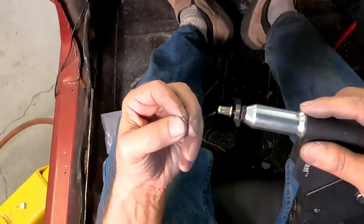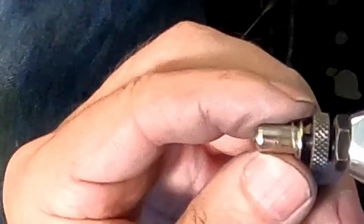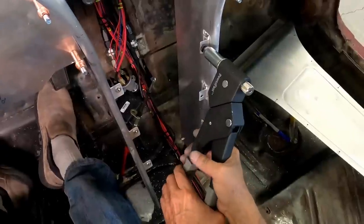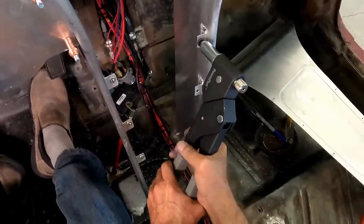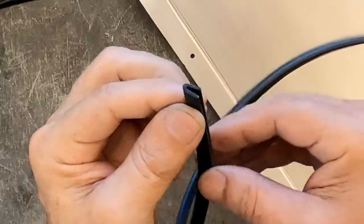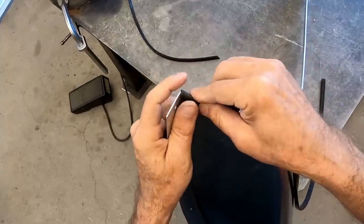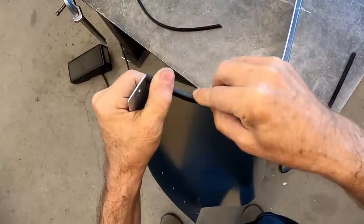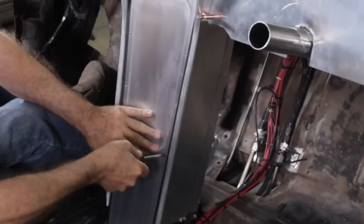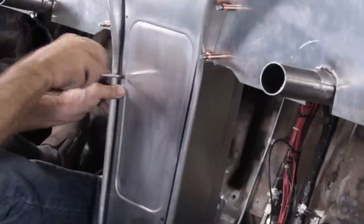I need about 60 thousandths clearance between the top of the 6-32 rivet nuts and the L bracket. These 30 thou washers came from McMaster and are placed underneath the rivet nuts — because one leg of the edging is about 60 thou, and smashing it down without the proper spacing would look stupid. The rubber used is ethylene propylene diene monomer, or EPDM, and is more tolerant to UV and chemicals — in other words, it won't crack and deteriorate as fast.